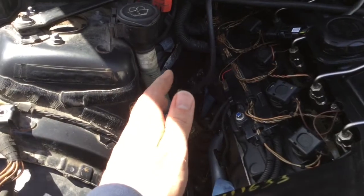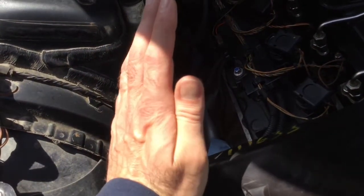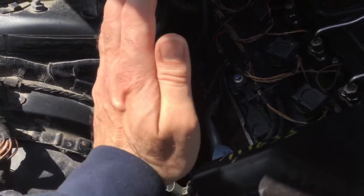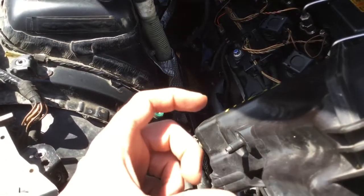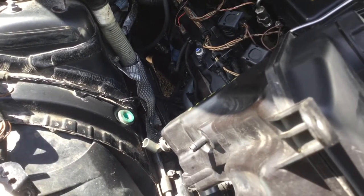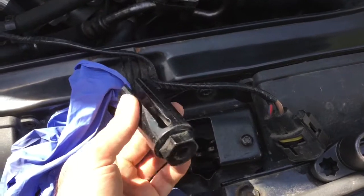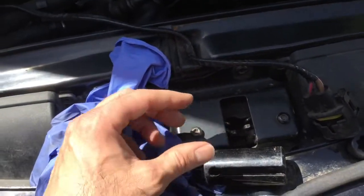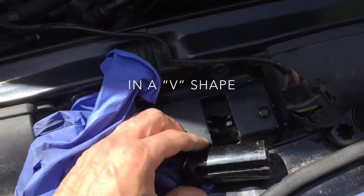The way to take out this pipe going to the turbo: first unplug it at the bottom from the intercooler. After that, remove the two collars, then tilt it back and take it upward. Be careful that the big part connecting to the intercooler doesn't damage the intercooler or the radiator. Also, of course, you need to remove the engine cover. Now the tool I used — I have a box socket special for oxygen sensors, but unfortunately this one doesn't work because the two sensors for Bank 1 and Bank 2 are positioned in a point toward each other, so the socket won't pass.